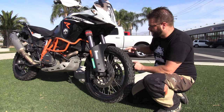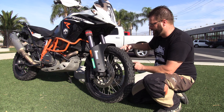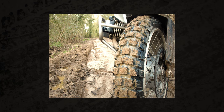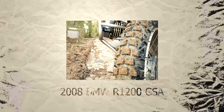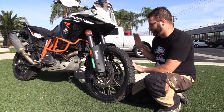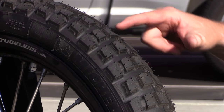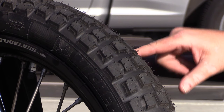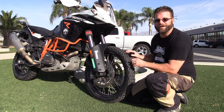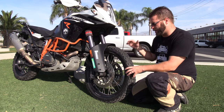Another unique design feature is that the faces of the tread blocks are actually scooped and angled backwards, while the backside falls off in the other direction. That's going to allow mud to not get stuck on a flat edge. I had a 2008 GSA and put these tires through their paces on that bike, and I'm really excited to see what it feels like with the 21-inch front and the 18 rear. The tread is built in an arch, which allows the tire to grip and grab. In the rear especially, that scoop allows you to dig into soft stuff and throw it out behind you.